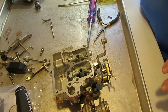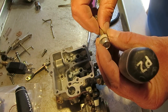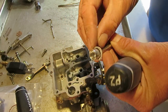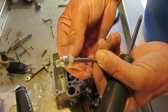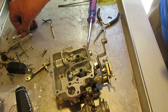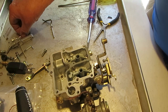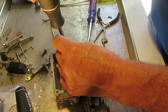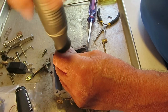The accelerator pump needs to glide in there easily. This one happens to be leather. When I go to put it back in, I'm going to work it like this to make sure the seal is broken on the outside — sometimes manufacturers will coat it for shelf life and you need to break that seal. Then add just a couple of drops of oil to the leather part, just two drops; you don't need to soak it. Now we're going to take the primary venturi off.